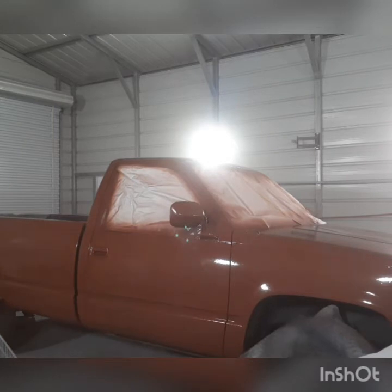Okay, I just want y'all to see how this primer goes on. I like to use this primer because, man, it sands so smooth before that next primer goes on, which would be the gray primer. Whenever I take a car or truck down to the metal, I like to use this first. And then I sand it with some 400 to 600. Then I come back and put the gray primer on it. But this is Sunday, it's just the first primer. Then I put some more on after I sand this down.